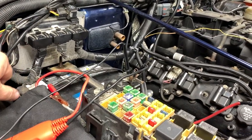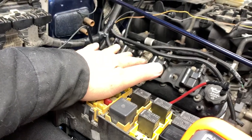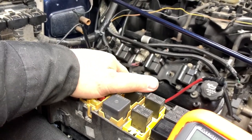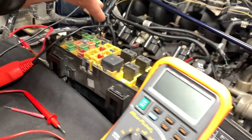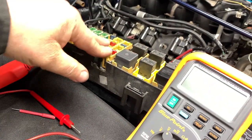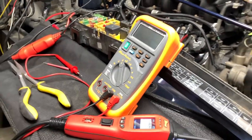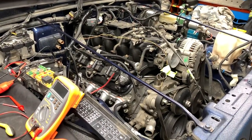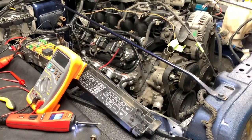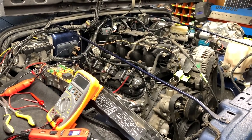I hope I got through the procedure for how it's wired up so you guys can troubleshoot it on your own. I'm going to be disconnecting pin number three and grounding it so the ASD relay fuse block can be utilized for my LS swap, since I won't be using the O2 or injector power from this. I hope you guys enjoyed this short video — if you have questions or comments, or if this is your first time here, please subscribe and follow along while I work on the LS swap. See you next video.